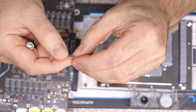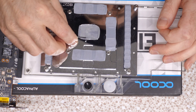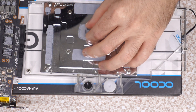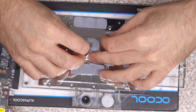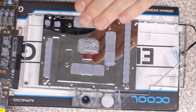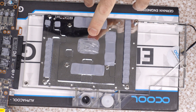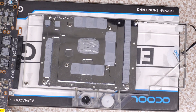Look at this — it's like a piece of rubber. It's just coming off in chunks of rubber. On one hand it's not going to compress very well since it's solid. But it's almost like if we just took these chunks of gunk and slammed them on the core, laid it out nice, and then reheated the card — got it wound up again — there's a good chance that stuff will soften up and spread out again. I'm gonna save these chunks for an experiment on a cheap processor to see if PTM 7950 can be reused with a little creativity in a non-critical application.